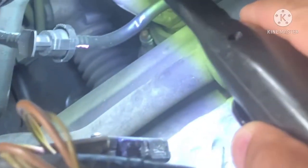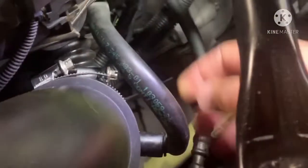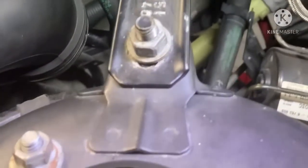I've been trying to do that for about a week, and I've done a lot of things. First, in this vehicle there's this lower intake hose right here, and there's this mouthpiece or rubber piece right here that was cracked. So I'm like, okay, great, I found the culprit. I ordered the new part, replaced it, and I still got the same error. After multiple drive cycles, I'm like, what could it be?